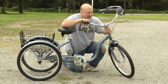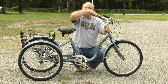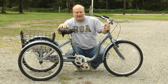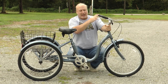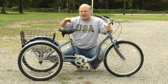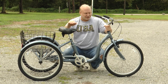I went ahead and put the gooseneck and handlebars on and snugged everything up. You'll want to keep the handlebars tilted up in the air — the reason is that on a tricycle you can't lean like a normal bicycle. When you want to turn, you will have to turn the handlebars quite a bit, and if you don't have them tilted up you'll be hitting your knees. Also, when you put your seat on, start at the lowest level, because when I first had it higher it was very difficult to pedal. Once I lowered the seat, I found it was a lot easier.